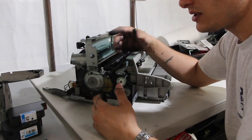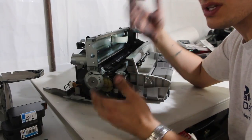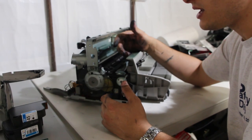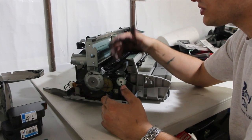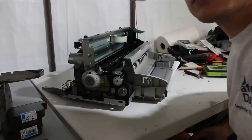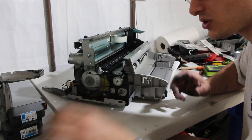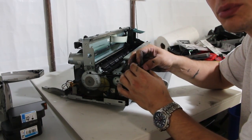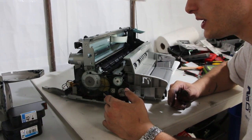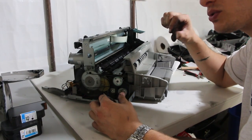Whereas a DC motor, if you stop it, it may stop in one direction, and then if you start and stop it again, even if it's the exact same time, the exact same voltage, you can't account for drag, whatever you have, and that means that the DC motor will stop in random directions all the time. So that's why you would normally use a stepper motor. Okay, so the stepping motor, as I said, you feed a certain voltage and it turns only a certain degree and then it stops. So very, very precise turning. A DC motor doesn't. Now what's very interesting, and I never quite understood, actually now that I think about it, I do know why. The issue with a stepper motor is you can only go to a finite degree.